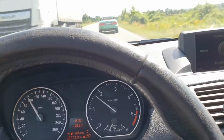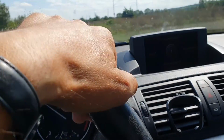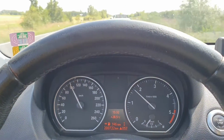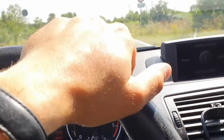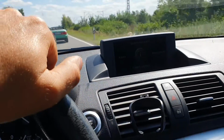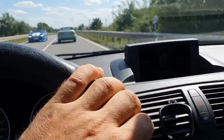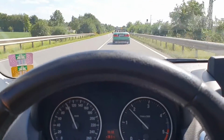Underneath, the gearbox mounts are perfect, the engine mounts are new, the engine runs perfect now. We have new particle filter, glow plug module, I'm not really sure what, fresh air sensor, no error on the dash, nothing, but this shake is from the flywheel, I'm pretty sure.